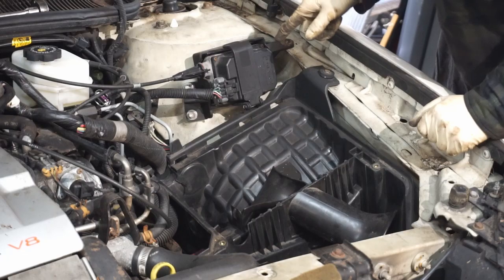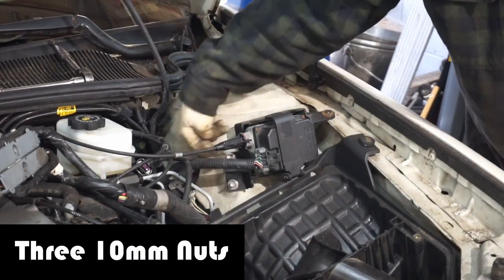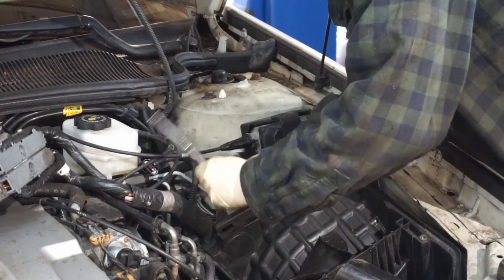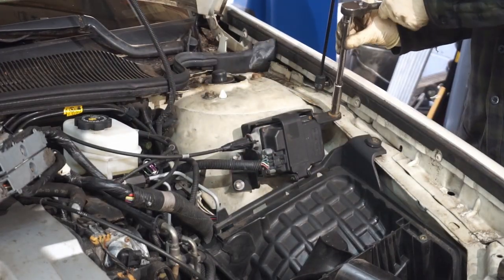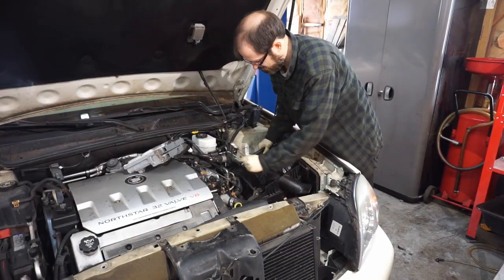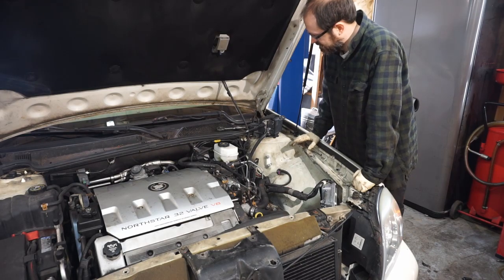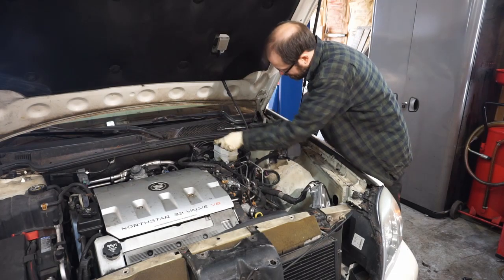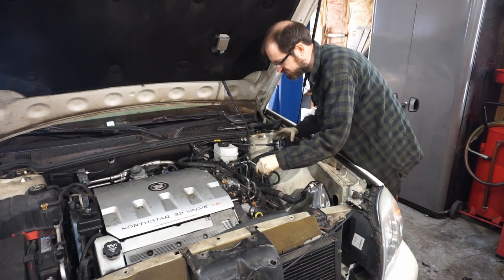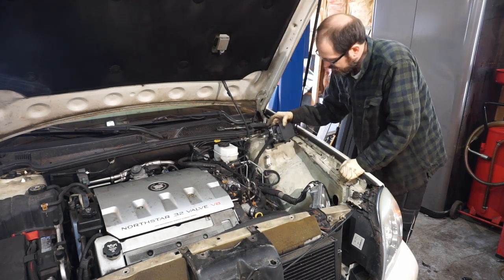Forgot about the cruise control module — that's three 10mm, and you're going to need a deep socket for these, and there's a 10mm here. Next up is removing the cruise control link here. The fuel lines — I'll show you the quick disconnect adapter you need to disconnect these. And then removing this bracket so we can get at the throttle linkage, basically to disconnect stuff. That'll allow us to pull this out.